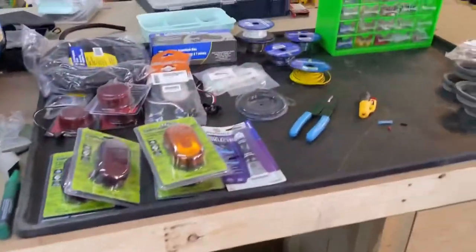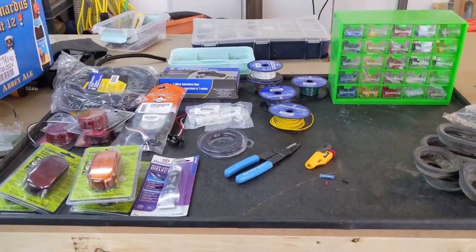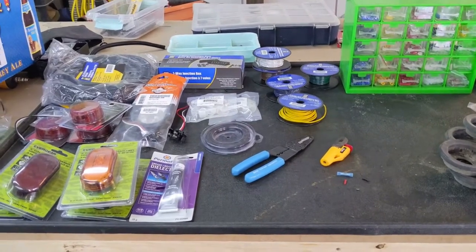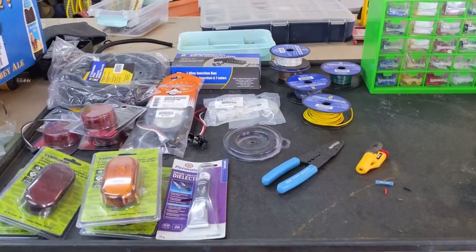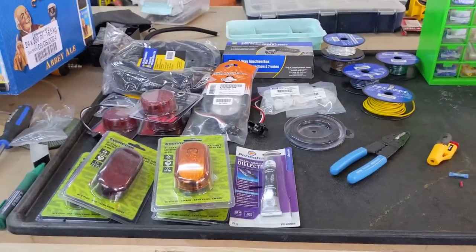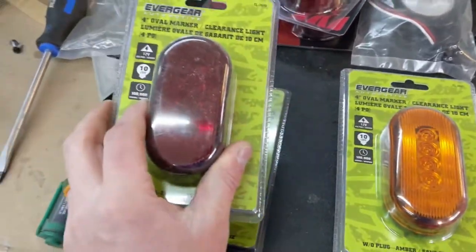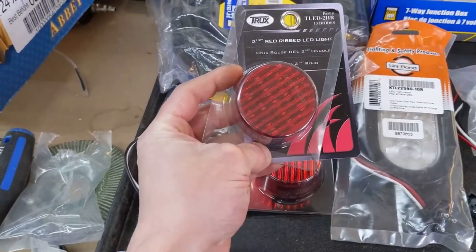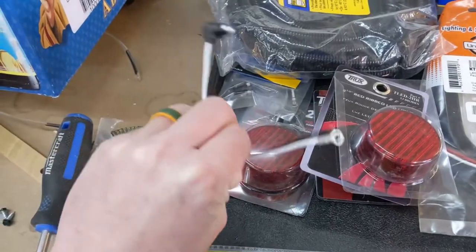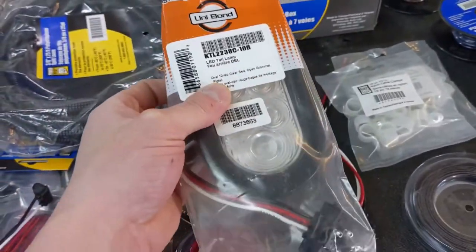On the back I've got tail lights — two 6-inch ovals and three 2-inch rounds. I went to the store and picked up everything I'm going to need to install the lights, short of fasteners. You want to make sure the fasteners are conductive — no special coating that isn't conductive — otherwise you may not properly ground your lights. Use a bare steel fastener. I've got my two LED yellow clearance lights, two red clearance lights, and three 2-inch round lights. These didn't come with grommets or wiring harnesses, so I had to pick those up separately.